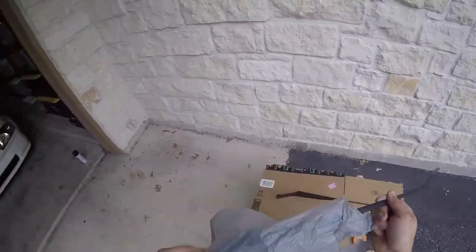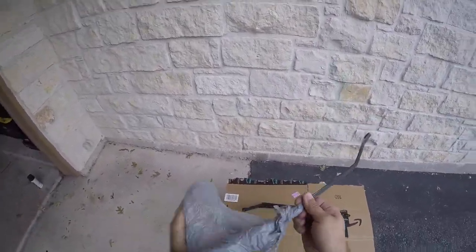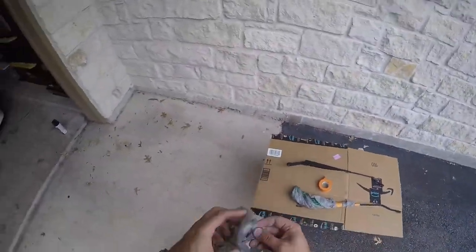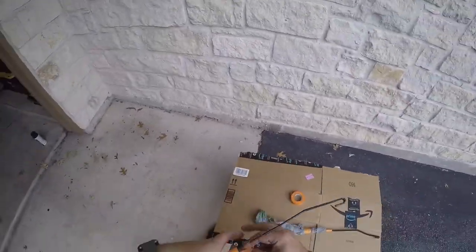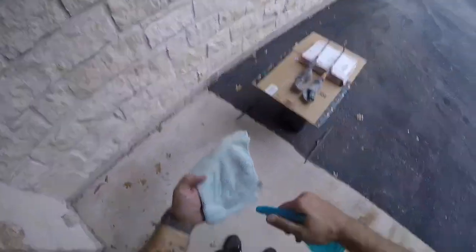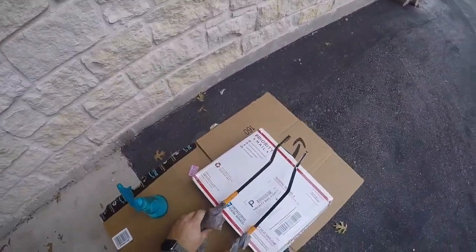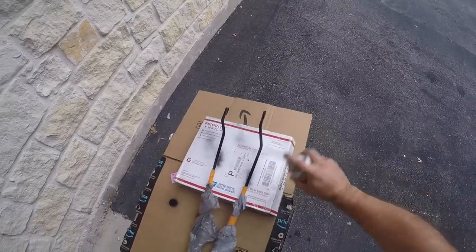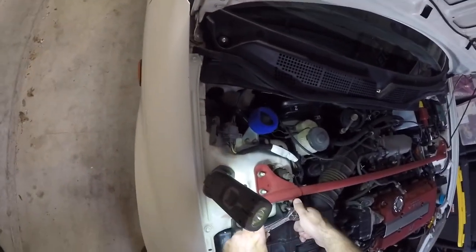I just tape off the bottom with a plastic bag so I don't get any overspray or extra paint on anything. Then I wipe them down with some alcohol and water to get all the extra dust off, and prop them up with the arms bent up so nothing's touching the boxes. The paint I'm using is just a flat black high temp paint. I also painted the heat shield on the exhaust.